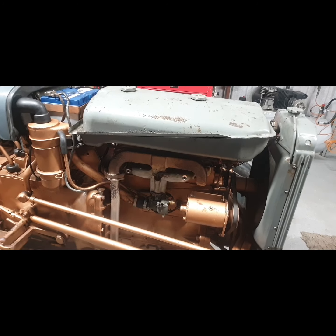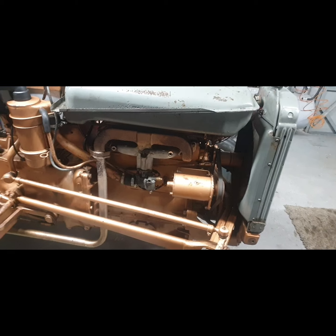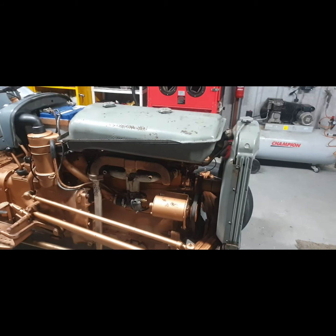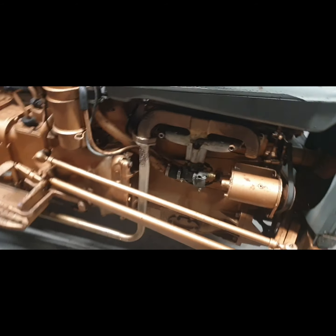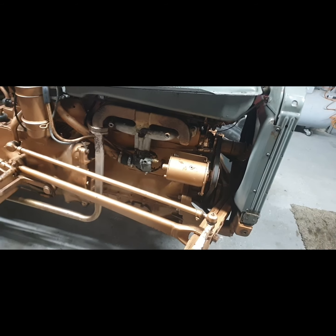I'm going to turn off the engine, leave the fuel on, and put a sheet of white paper down there for a while to see if there's a drip. After leaving it on for about half an hour, there's no fuel in there and no fuel coming out. So it's safe to say, up to now, the float needle valve is sorted — we'll turn off the fuel for tonight and see if that affects the running next time I take it for a spin.